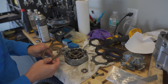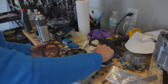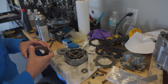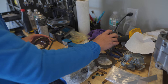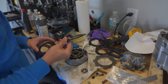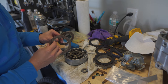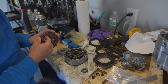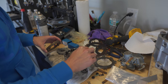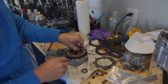Chad at CHP Motorsports explained that in the earlier bikes like this one, they had clutch material on both sides and the center plate was steel on both sides. Honda changed it later because the motor oils used previously would put too much pressure on the all-steel center plate, but with the wet clutch protection and detergents in current motor oils, the old style designed for this motor will work fine. He said the two types are interchangeable, but since I already have these new clutch plates and have an order shipping from CHP, I just paid $10 to have them send me the original steel-on-both-sides center plate — so the arrangement will be clutch plate, all-steel center plate, then clutch plate.